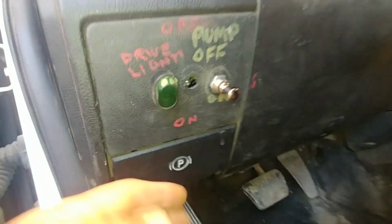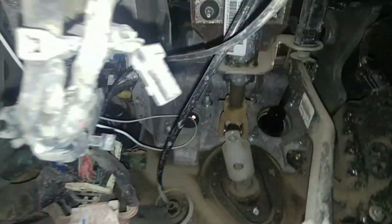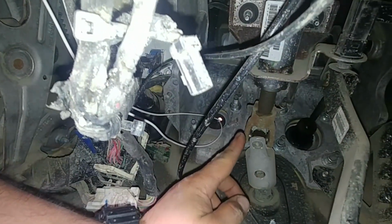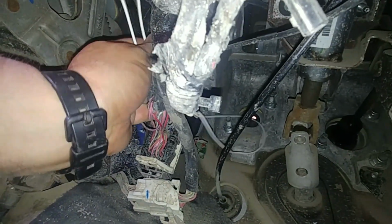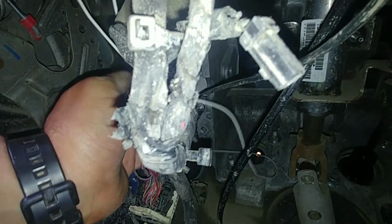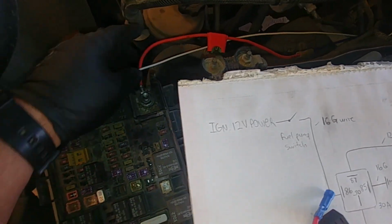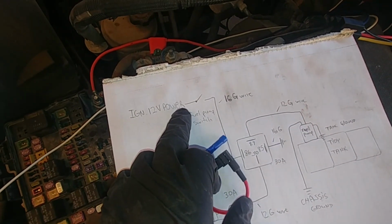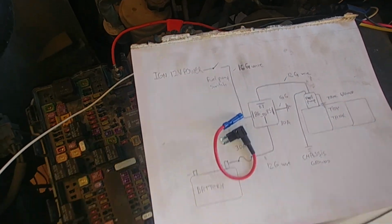Measurements, we have our panel with the switch installed, and make sure your wiring is not tangled around the brake panel, accelerator, or any other components like this bar steering column shaft. Just give yourself a little bit of loom, make sure it's free for now, a little bit loose, and we'll put a loom and tie it to the original vehicle harness. We only have one wire left, which is this 86 from the switch to the ignition 12 volt power.